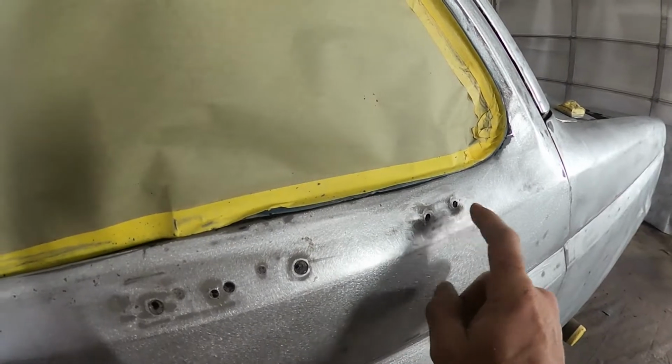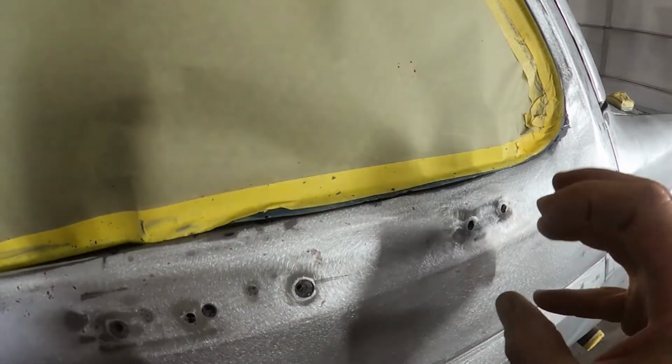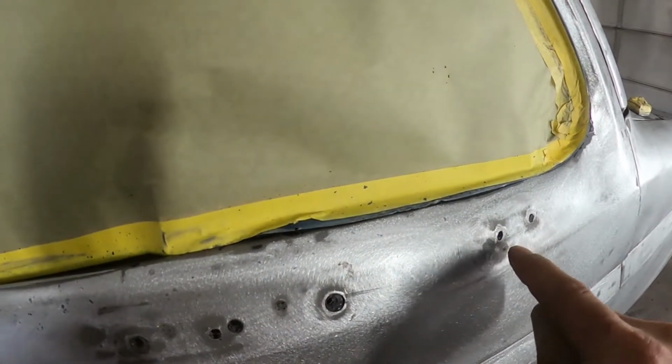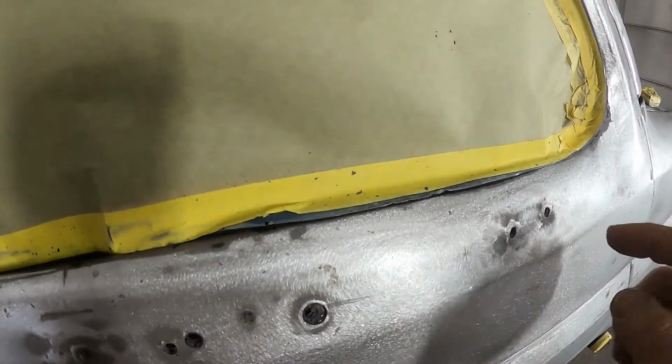But these I do. I have to actually get my shrinking hammer around these. And these have been hardened. When they got pulled out initially by that lag screw, they had hardened them. And so it's difficult. You actually have to knock all this in just a little bit. So this is all going to be dented in just a little bit.